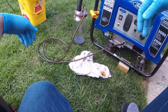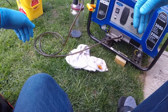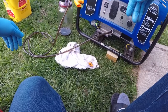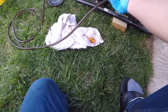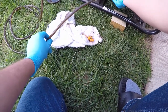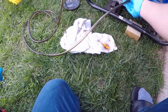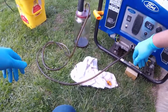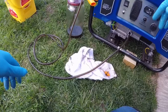There we go. Pull this back out so you get a little air in there — you can see it moving. You see the air pocket going back into the oil, and there's our oil chasing through. I believe this generator holds 20 ounces of oil. I'll let this go and bring you back whenever it's done.